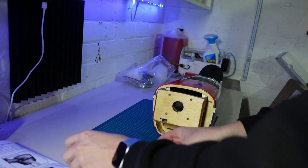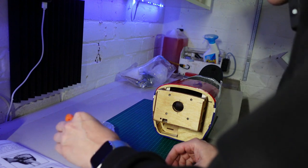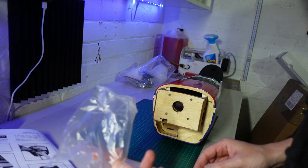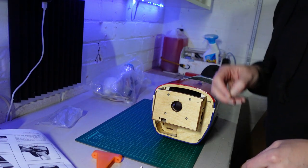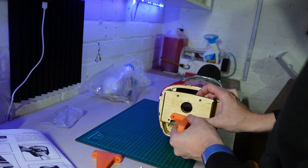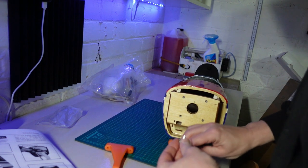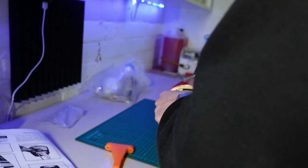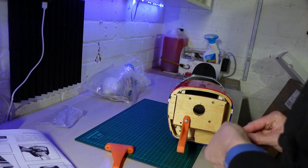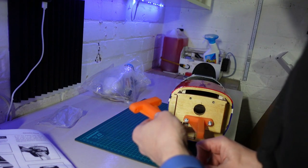This is the engine mount pack and it's designed for a 46, which is the same size as the engine I've got, although it's slightly bigger. I appear to have four washers but only two bolts - brilliant. I've managed to find the bolts thankfully. So we're going to mount these like this - that's going to be the bottom one and the top one goes on there. It does say to use Loctite on these but just for now I'm going to get it screwed into place, make sure everything looks okay, and then I'll take them back off and Loctite them.